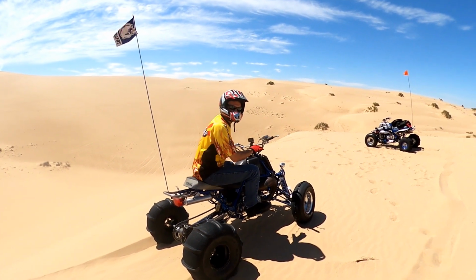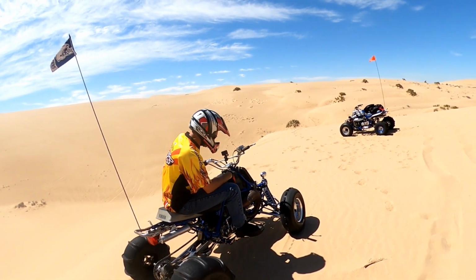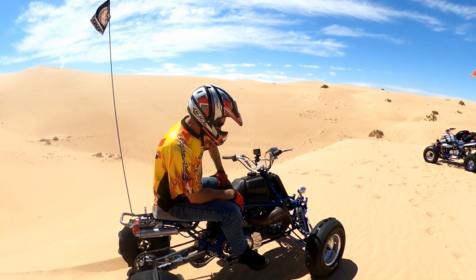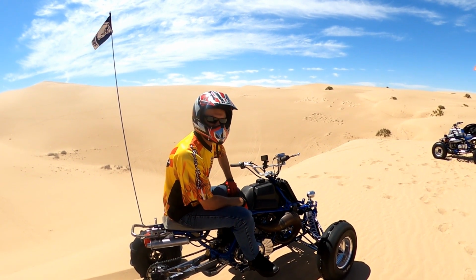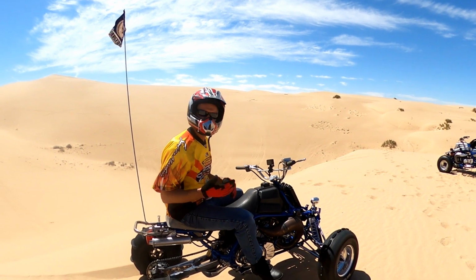Wrong with this one. Yep. Sometimes it will, sometimes it'll get on the pipe and sometimes it won't. It doesn't matter where the RPM is. It's not a jetting problem because sometimes it's on fire and then sometimes it's not. But we ran all the electronics on it and it's a hit and miss problem.